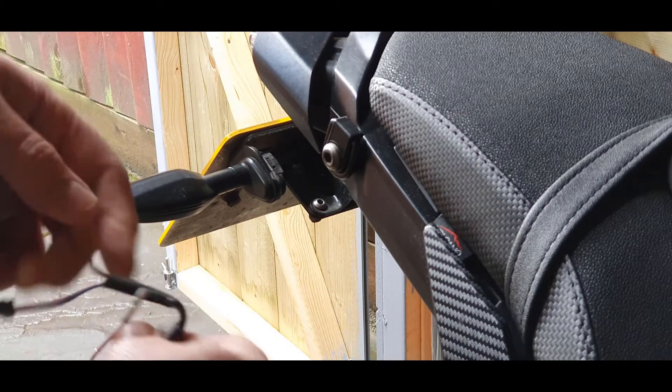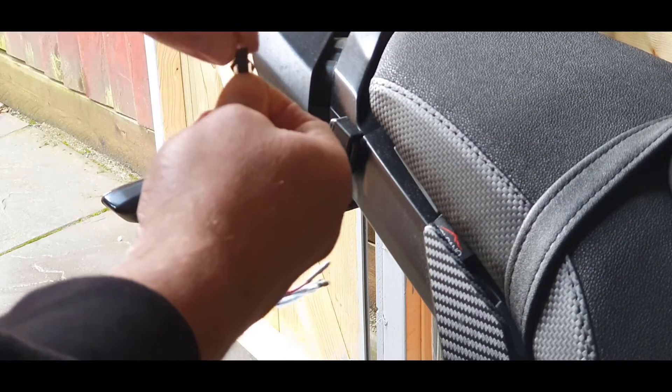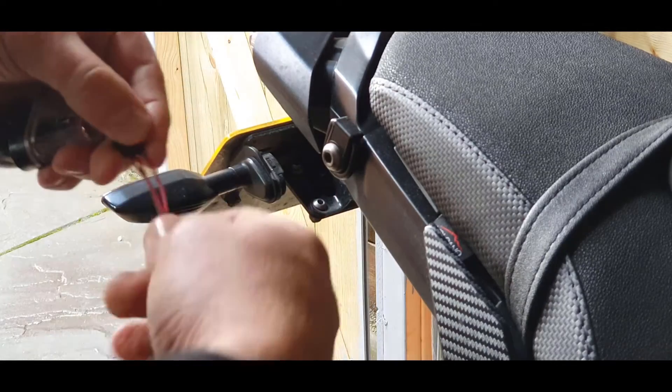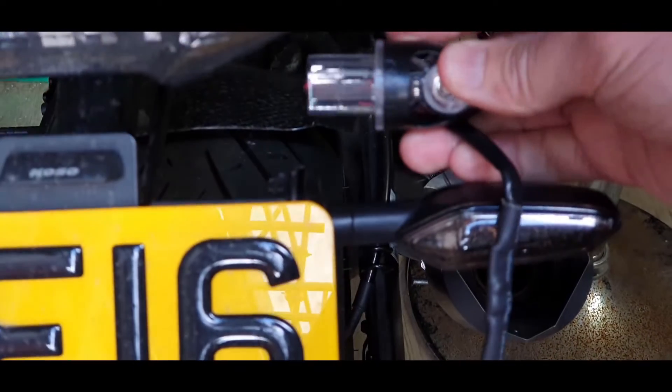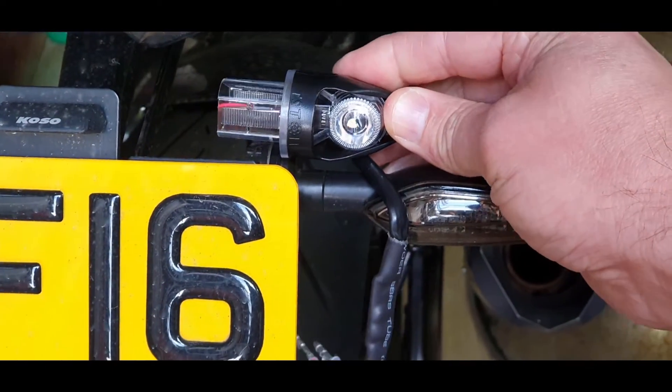When fitted in the back you're going to have a red glow and for it to look any good you'll need to tape up or black out what you can see on the other side of your tail tidy. The wiring and electronics will fit under the tail tidy and run into the back of the light where you connect to the original indicator sockets. The cable from my experience is probably going to be too short and will need extending. You'll also need to wrap up all the exposed wiring where it's going to be pelted by debris kicked up.